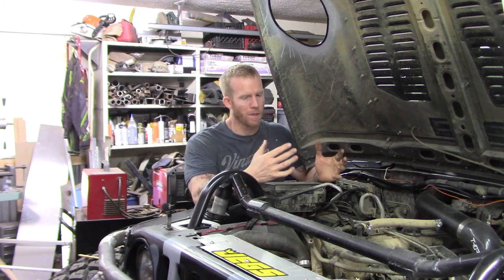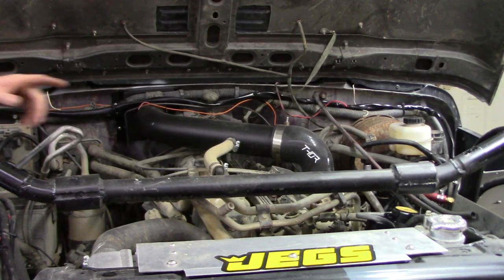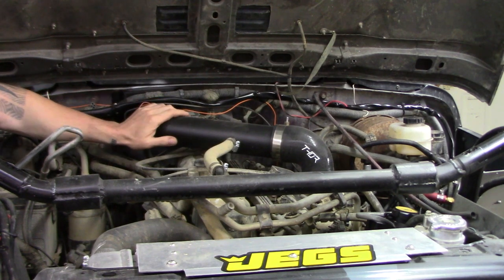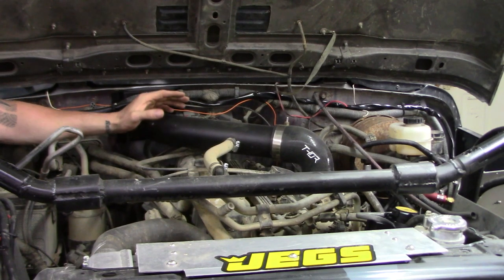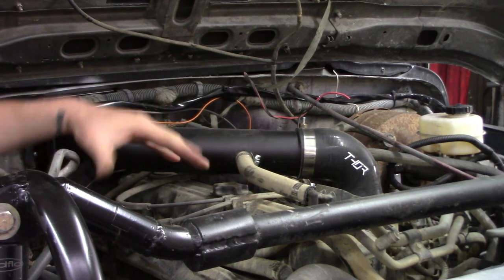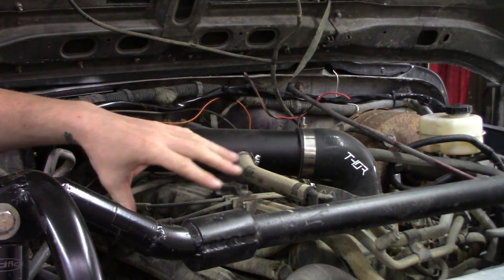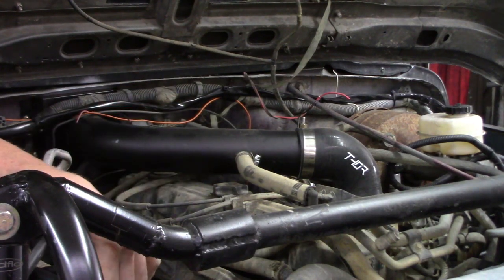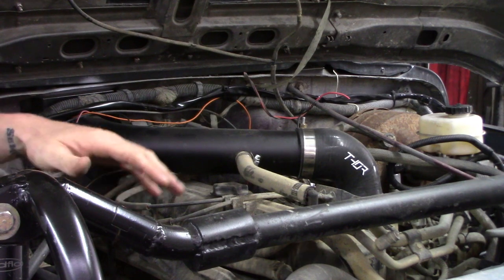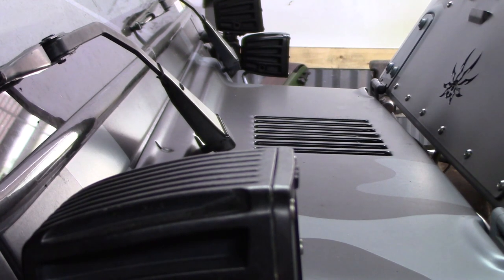So there's a lot of choices out there. You can obviously do it with a K&N setup where you just have the open cone filter or a rechargeable filter. But when I started asking around, a lot of people mentioned the Trailhead setup. When I looked at this, I'd never even seen it before, and right away I knew this is what I wanted — mainly because it's a clean look and it gets the filter out of the engine bay, pulling cooler air. On K&Ns, they usually route toward the fender wells, but if you're doing a one-ton swap, more than likely you won't have the stock fender setup. When I saw this routes into the cowl, that's nice because you have your air vents on top of the cowl, so you know you're pulling fairly cool air through there.